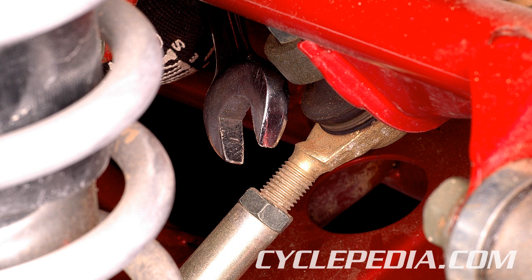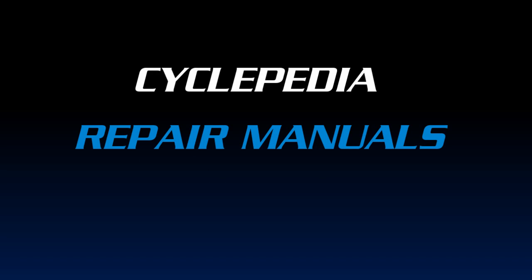When the adjustment is correct, hold the tie rod flats and tighten the lock nuts to specification against each side of the tie rod. Take a slow test ride to make sure the steering functions correctly.